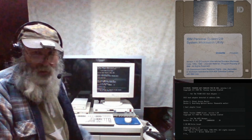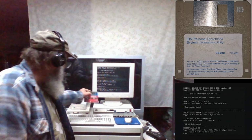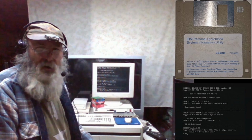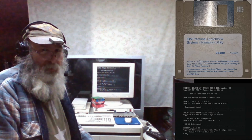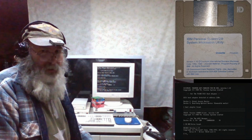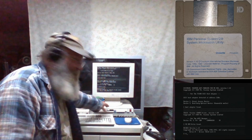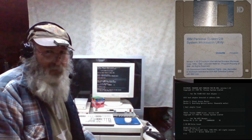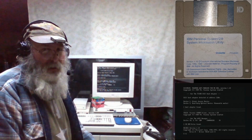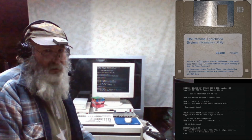And this is the 8086 based Model 30. I've shown this before. And it's funny that this is the kind of go-to system that I'm doing for making the starter and reference diskettes. The video I did on making the starter diskette was from the system. And normally this has a 720 KB diskette drive, but I've gone through and changed that out years ago for the 1.44 megabyte drive. It's an easy swap in. You don't even have to change the configuration. The system just goes with it and understands that you've changed the diskette drive out for a higher capacity unit.